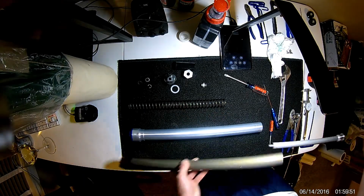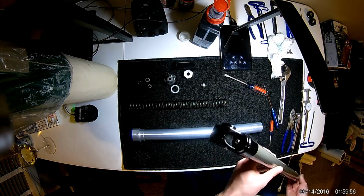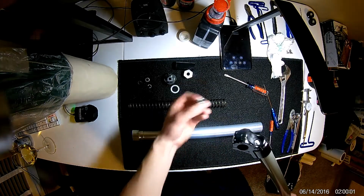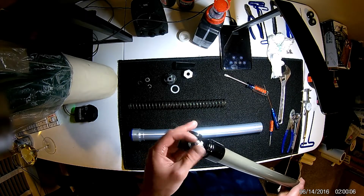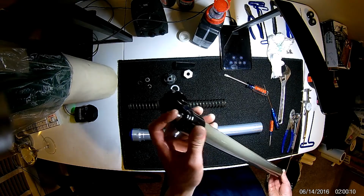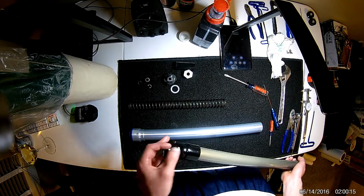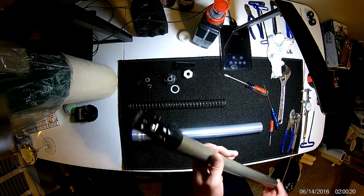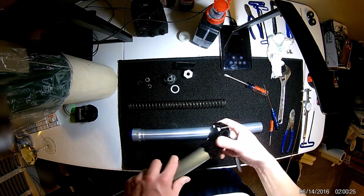Okay, so we're going to slide the cartridge back down into the stanchion. You can see we're protruding out right there. So take your nut, thread it on. Doesn't hurt to put some fork oil or some O-ring grease or something on that seal. My fingers are oily as is, and I wiped it off with the oily rag, so it is already pretty well lubricated. But we're then going to want to tighten this up.